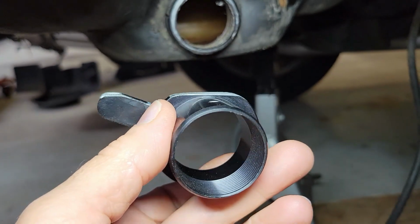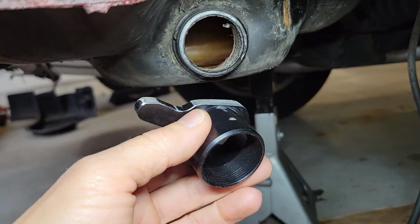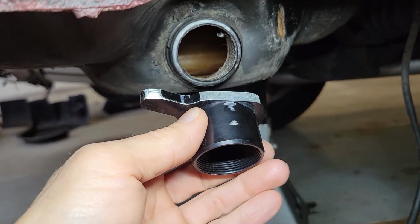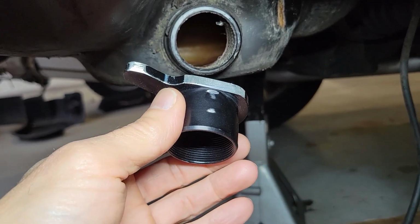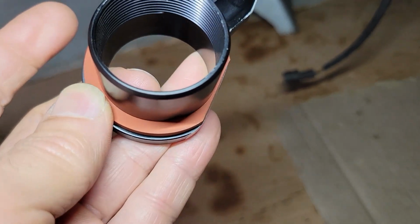Fortunately, 928's RS has a repair piece that goes in from the inside, but it needs to be ground down to fit the 944 fuel tank, at least on my 87. Let's see how that fits. It also came with a gasket. Had to trim the gasket down.